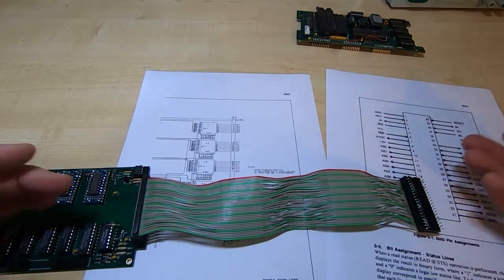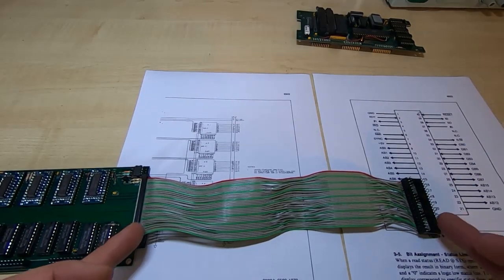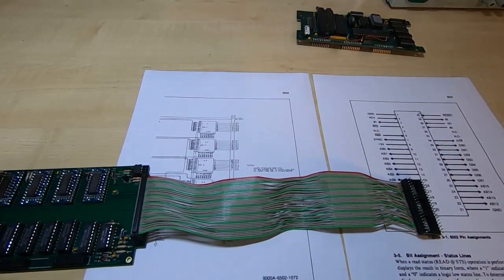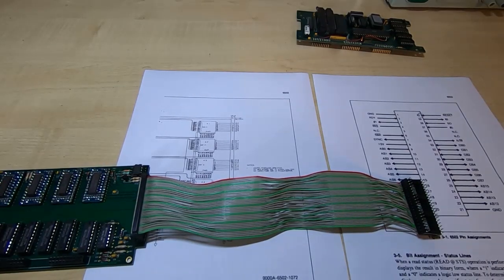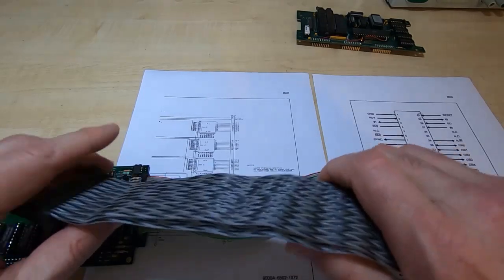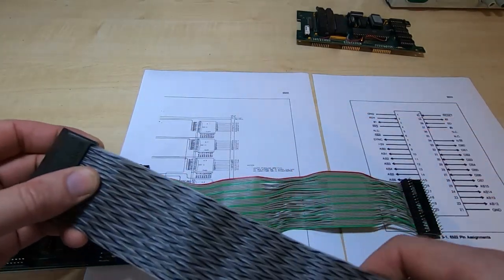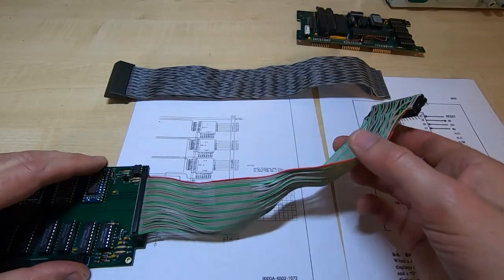The advantage with these: A, it's pretty much free — you've probably got the parts lying around — and half an hour's work and you've got one you can use. With a single ribbon cable, if you cut it in half, you get two. This is the bit you really want to avoid having to make — these aren't difficult to do, but it's just one less step if you get a ready-made cable. By the time you've bought the cable and the IDE connector, it's just as cheap to buy an old IDE cable for a PC and cut it in half. The originals are quite stiff, probably partly from age but also they're quite thick cables, and they can be annoying to use because you can't easily bend them. Whereas this is extremely supple and flexible — you could tie a knot in it if you wanted to and it'd still work.